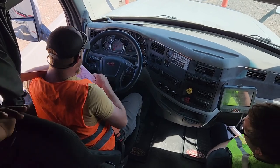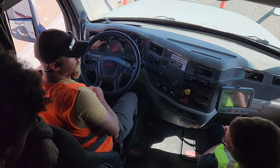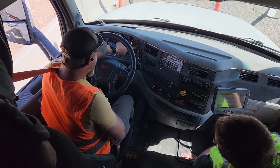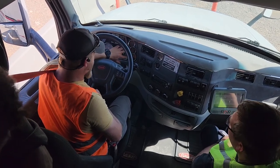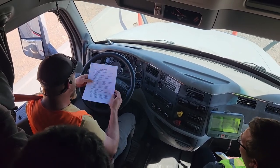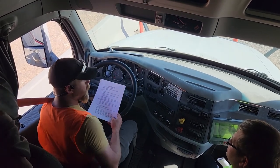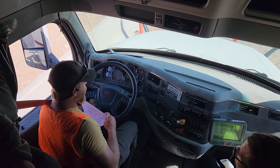While we're waiting on that, we've got our fuel gauge, DEF, or diesel exhaust fluid gauge, our coolant gauge, oil gauge, primary air, and secondary air. The only ones we're worried about right now are these two. Right there, okay? That was the governor kickoff. Now that we're built up, we're gonna turn the truck off and just turn the key on, one click.